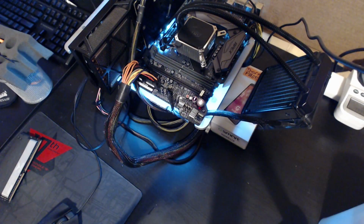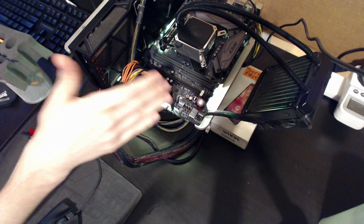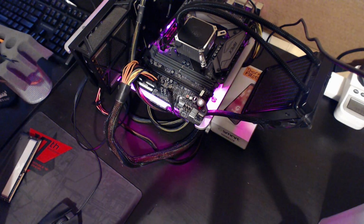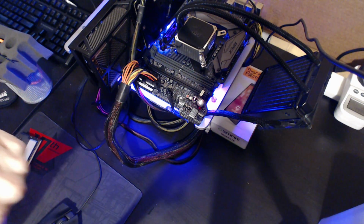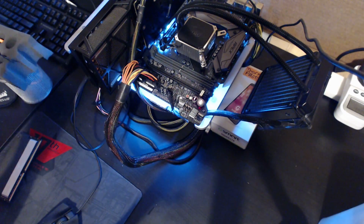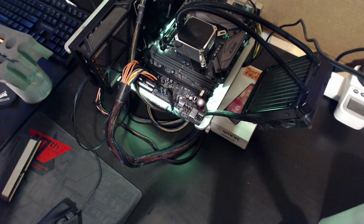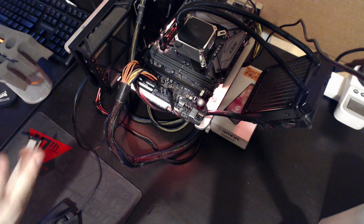Basically, as far as I'm aware, if you're trying to overclock B-die for DDR, for the timings I was running, so 12, 11, 11, 28, with most 4-DIMM motherboards, you're looking at about 3866. You're not really going to be going much above that. Very few 4-DIMM boards can do 4000, 12, 11, 11, 28, regardless of what kit you stick into them. Some 4-DIMM boards are capable of doing 4000, 12, 12, 12, 28, which isn't as difficult to do, and it's also a lot more common on B-die memory. 4000, 12, 11, 11, 28 is actually above average.